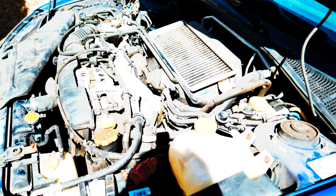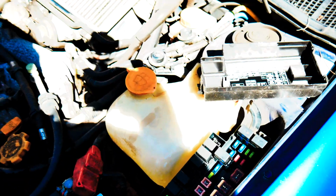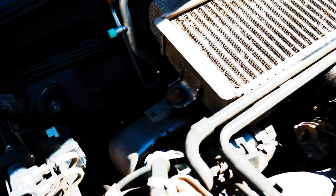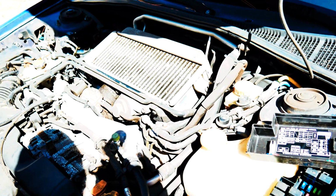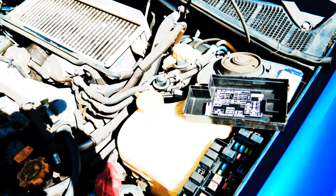Alright, so we are out here trying to see what is going on here. So it looks like I need, does this pop right off? It should be popping right off, open right here. There we go. So I just need to pull these fuses and see if one of these might be the reason why it's not shifting in. The other one, it could be, I know down here you can see the mechanism. It's really dark, but down there from the videos that I watched is where you see the transmission go in and out of gear. When I looked, this is the hose that needs replacing, so I need to go buy a replacement for that. All the coolant leaking there, but it does have coolant, it does have a little bit of oil. So I'm going to check the fuses real quick. Looks like I have some spare ones in there, and try to figure out which one's the one that activates that solenoid. Could be the solenoid's bad, so we'll take a look.